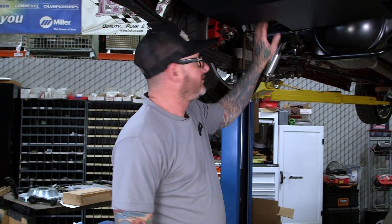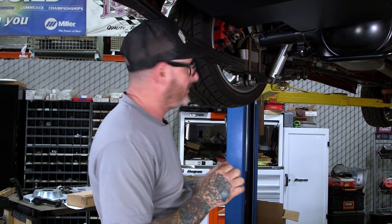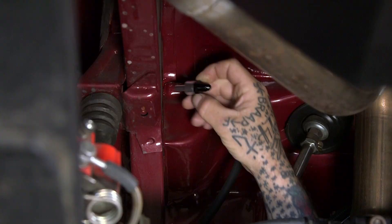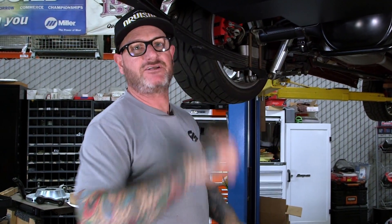Here are some other good ideas with our Dash 4 easy fitting. You've got your rear end you need to vent — go ahead and take your hose, twirl it up, zip tie it somewhere. It's not so cool. Take one of these, hit your 5/16 hole in your frame rail, pop it in there — now it vents right into your frame rail. You can also do that with your gas tank. Some other ideas: your radiator, if you want a steam line — put a little hole in your radiator, put one of these in, now you've got a steam line.